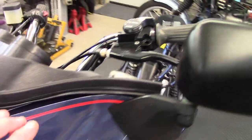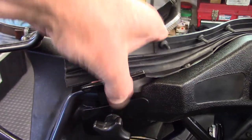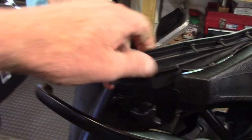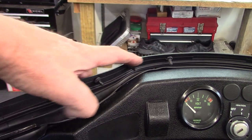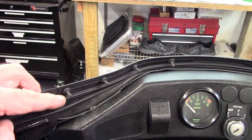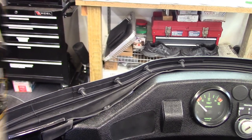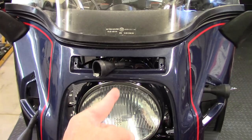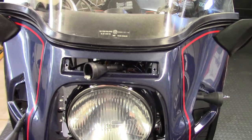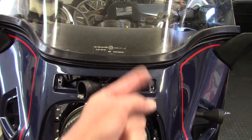I have the bolts attached through the gasket and securing the dash to the top fairing panels. These two holes are where the center plate that holds the center of the windscreen onto the dash will go. On the back there are also a couple of flaps that slide up around the adjuster bracket. I have the windscreen mounted with the center plate and I pulled out the headlight to get more room, lowering it so I could get my fingers up underneath to tighten the two nuts that hold the center plate in.